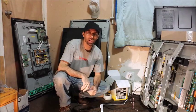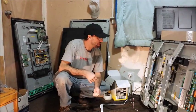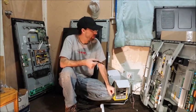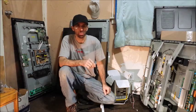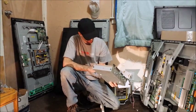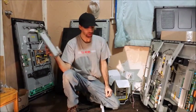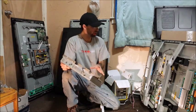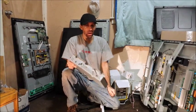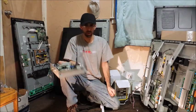Chris here from Swappart.com. I'm going to do a quick video to show you how to put your panel into test mode. Now obviously all plasma TVs are different. This happens to be a Sanyo DP50747, and if you look on the side of the main board you can get your version — this is a J4DE, so this is actually a good main board. I just pulled it so you could see how to know if you need a main board, because if your TV's not coming on and you put it into self-test mode and it does come on with the main board removed, then you know your main board is bad.